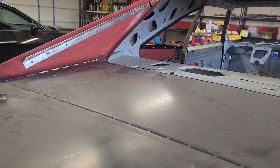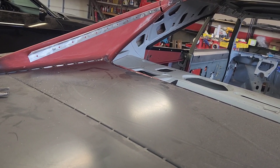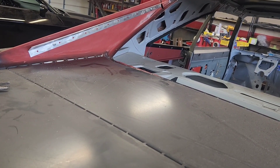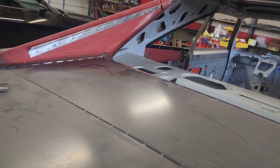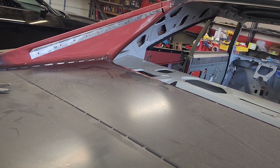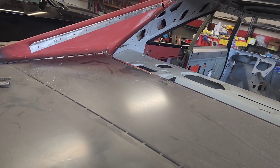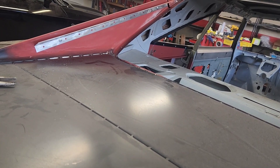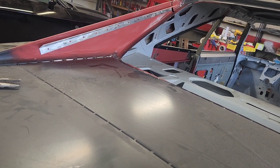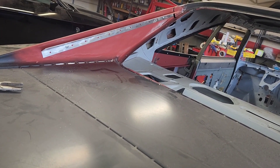The flange now has screws - one on the top and one on the bottom - through a slotted hole so I can adjust it up and down to get the window bed decked out to where the sheet metal makes a good transition. I've also pre-drilled and primed this so that once it's in position, I'll be able to plug weld this flange right to the side there, and that'll support the window bed on the sides.